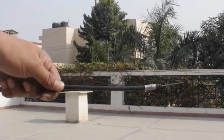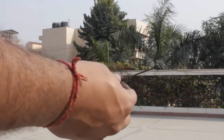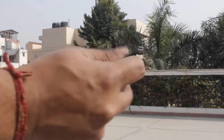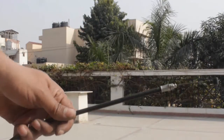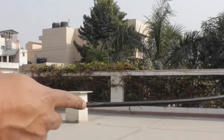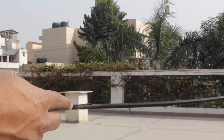This is the clutch cable that we have taken out. Normally you can just lift this place up and put a few drops of oil in here and move it so that the oil goes inside. Once you have done this the oil will be nicely inside and you can clean up the cable and replace it. But here, as you can see, this place on the cable has worn out.